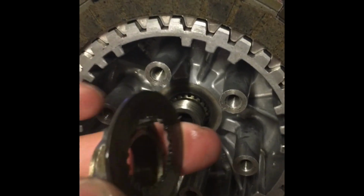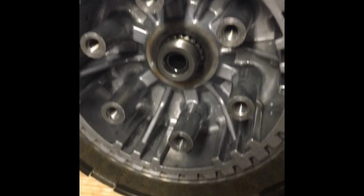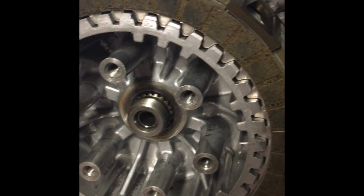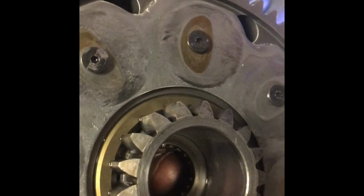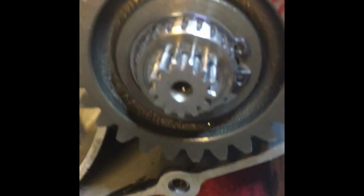And so here I'm documenting, okay, I took off the nut. There's a washer behind the nut. Another piece of this is, anytime you remove a washer or a part, look behind the nut, look behind the part, look behind the shaft. There could be a very thin and maybe even rare washer or spacer sticking to that part because of oil residue. You may not realize it, and it may wind up on the shop floor, lost, and then you don't know where it goes. Nothing worse than winding up with a bunch of parts and realizing you put the motor back together and you forgot a washer.